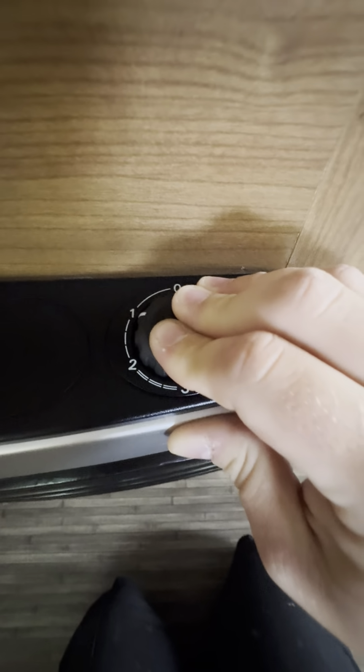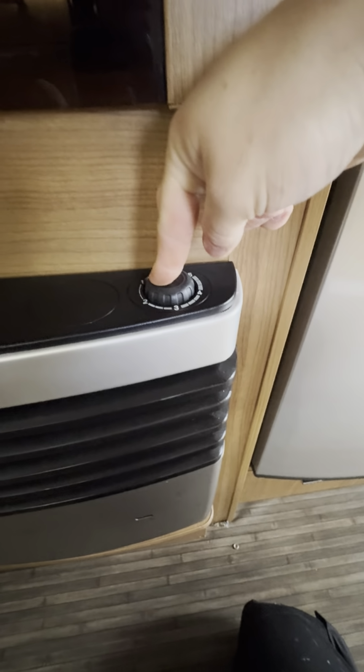So now all the time that I'm holding this down and it's lit, that is our pilot flame. There's a little bit of orange there. It's not being used for a little while. That's absolutely normal. So now what I'm going to do is lift this up and twist it round to about three or four. So lifting it up, and if you watch what happens when I turn it around, main flame kicks straight in.